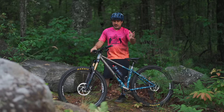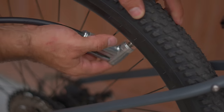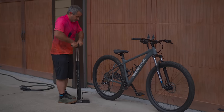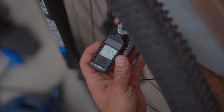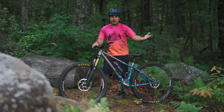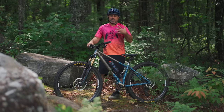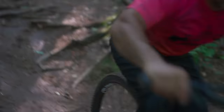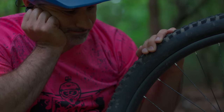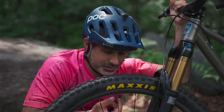Maybe today you're riding smooth hard pack trails, flow trails, swoopy berms, jumps, and rollers. Try increasing your tire pressure — if on normal single track you're running 22 PSI, try bumping it up to 30. That gives you lower rolling resistance and allows your bike to carry more speed. On the contrary, if you're riding really chattery terrain with lots of little bumps in quick succession, lowering your tire pressure might actually make you faster because there'll be fewer vibrations, better control, and better tracking. Just don't go so low that you have sketchy problems. And the best thing about changing your tire pressure? $0.